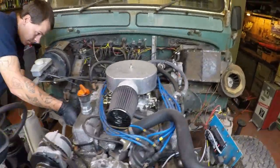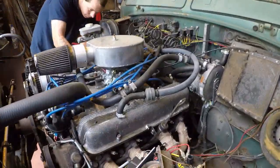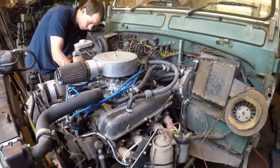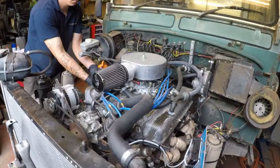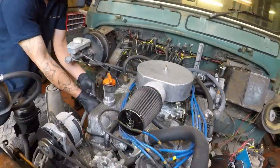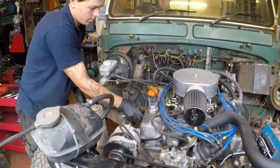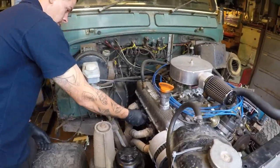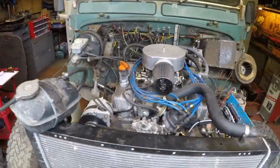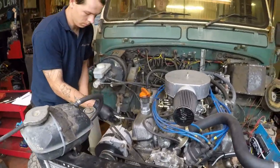Also, I forgot to mention: you need to disconnect the ignition system and the fuel system, because you don't want fuel going into the chamber — that's going to skew the reading — and you don't want the ignition system on because you might give yourself a little shock. It's a fair amount of voltage — over 11,000 volts — but a very small amount of amps, so although it hurts, unless you've got a pacemaker you'll be all right.